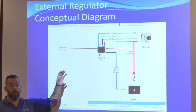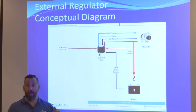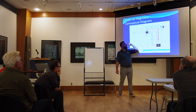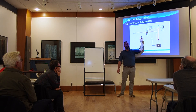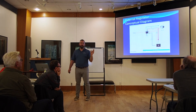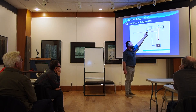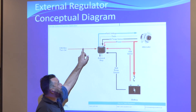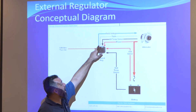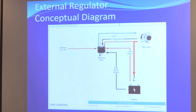That's just powering it — just having it turned on, like your TV plugged in. Then you need the regulator to actually be turned on, and that happens via the ignition wire — this brown wire right here. You'll see a light on the device telling you it's working. Once it receives power, it's been told to turn on, it's going to output on this blue wire the field voltage. That's actually what drives the alternator.